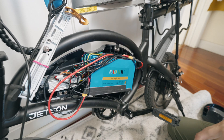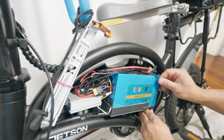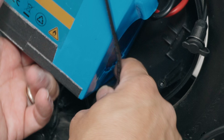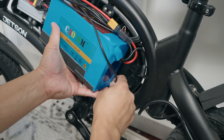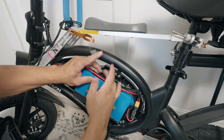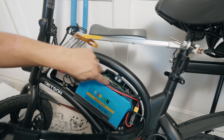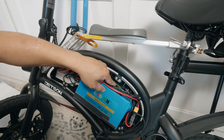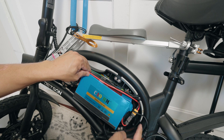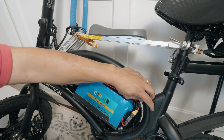Now that I know that this thing is going to work, I'm just going to tighten this up. This pedal assist cable is kind of a problem, but we'll see in a second. If I put it down here it's going to pinch, but if you look at the very corner there's actually a tiny little gap. So I'm going to put it in that little gap. That is about as flat as I can get it. I'm just going to use a little bit of tape just so it doesn't run all over. It was pinching on these tiny little wires, and that is the last thing you want to do. So back here it's pedal assist, power cable, charging cable. You just have to do it in that orientation, otherwise stuff is just not going to fit.